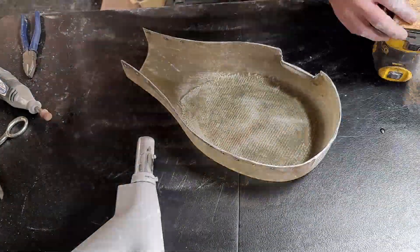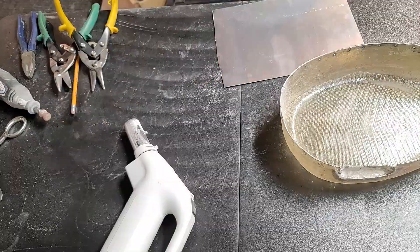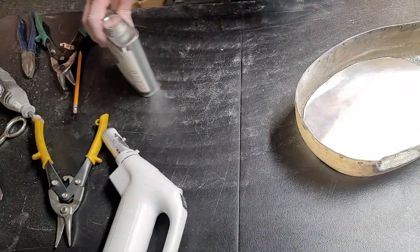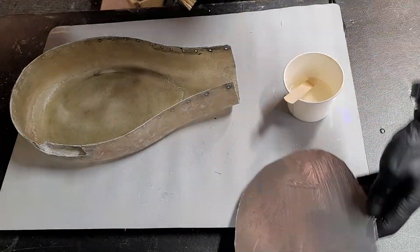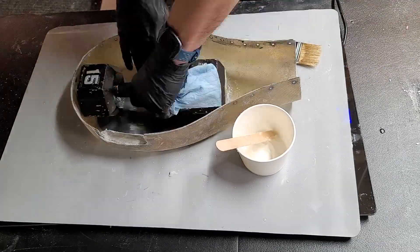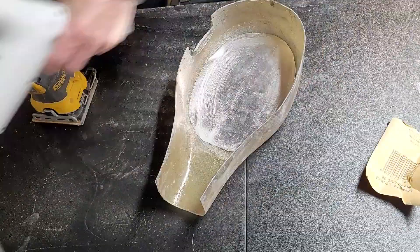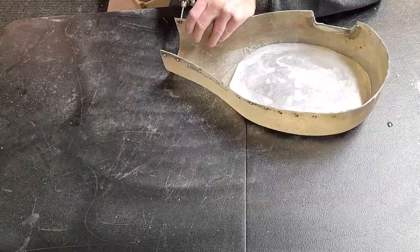The thing has now had the inside reinforced where it was worn through, and the whole outer side was reinforced. Now I'm going to take some aluminum and through trial and error cut a piece that fits where the filter is going to go inside. That way it will act as a stop for abrasion, and it will never wear through the bottom of the airbox ever again. I'm going to start by putting some wet epoxy on the aluminum and on the fiberglass, and spread some flox on the aluminum and around the edges to smooth it all out. Then we'll get some weight on there to make sure it cures up properly. It's cured — now we have that aluminum in there. We'll sand off any rough edges from leftover flox, make sure it's nice and smooth, do the rest by hand where the sander can't reach.